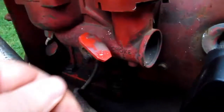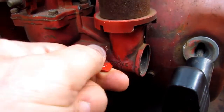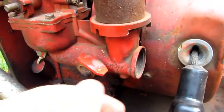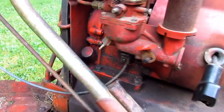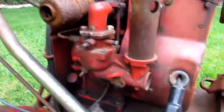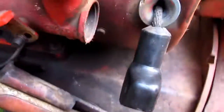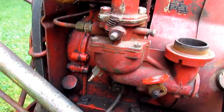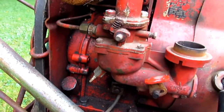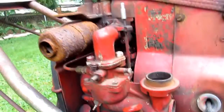You turn it on — choke on. I can't really see in there, but it puts the choke on. So you put the choke on to start, and start it. Once the engine's running, you take the choke back off for running, and that's reachable from under the cover. The long screw goes down through here and actually screws in down there. I believe mine is complete — I don't think I have anything missing. I don't know that for a fact; I haven't run this machine yet. Just bought it a few months ago, but as far as I know, it's complete.